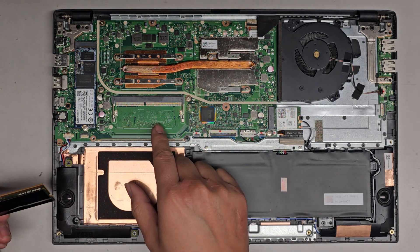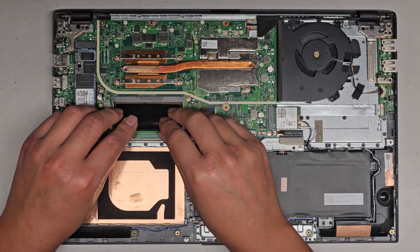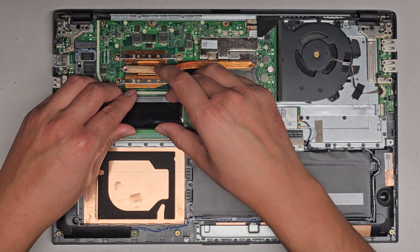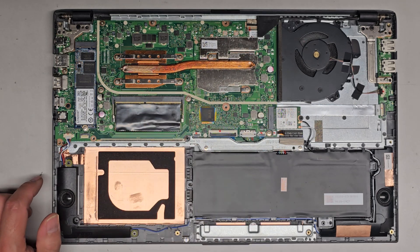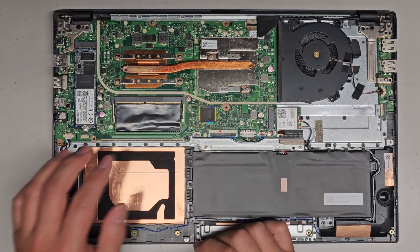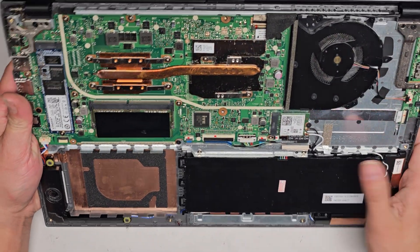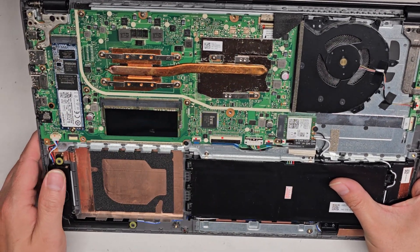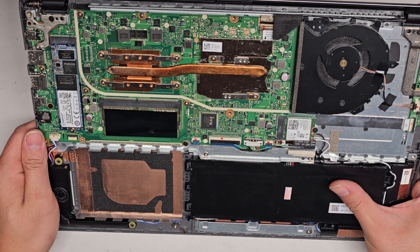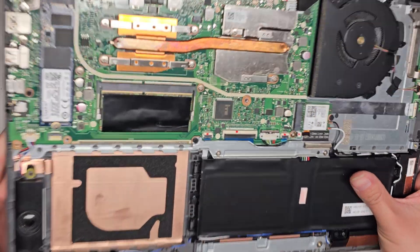If there's more RAM, it's soldered to the motherboard somewhere. You can upgrade this to as large as you want. I don't know if they have 16 gig sticks, but you can upgrade as large as you want. Usually it doesn't matter as long as you match the type of RAM, which is PC4-2666V or DDR4 RAM at 2,666 megahertz.